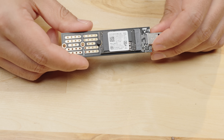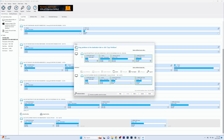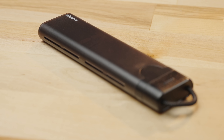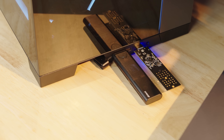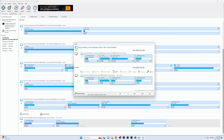You'll also need an M.2 to USB adapter to clone the SSD. Cloning is the way to go on this device — you don't want to install a blank SSD and try using a Windows USB key. We have two different M.2 to USB adapters in stock, one with USB-A and another with USB-C. You should go with USB-C for better transfer speeds. We'll use one to house the old SSD and another to house the new SSD, and we'll use Macrium Reflect to clone the original SSD.